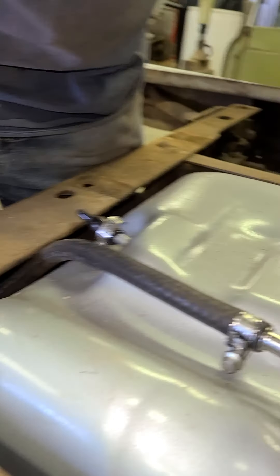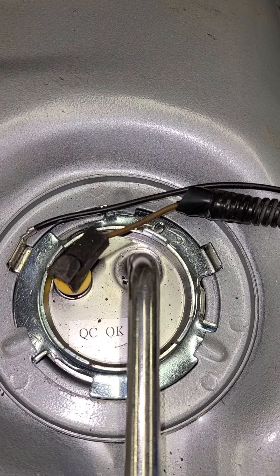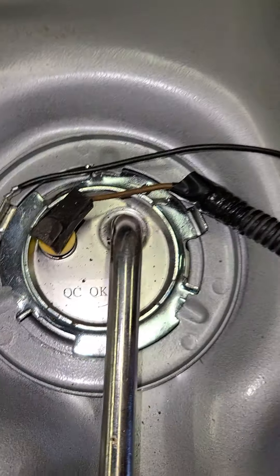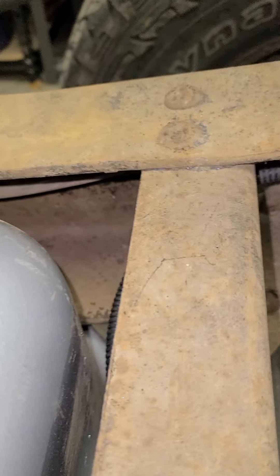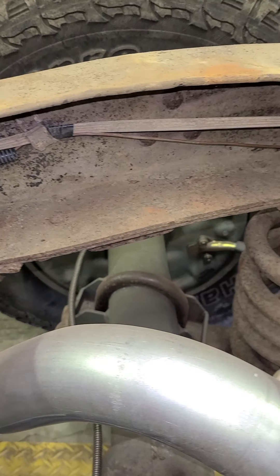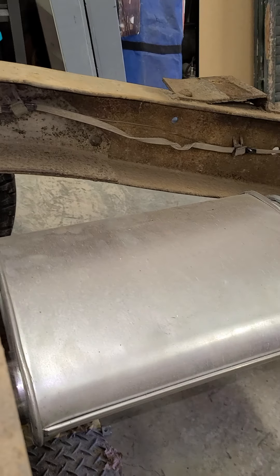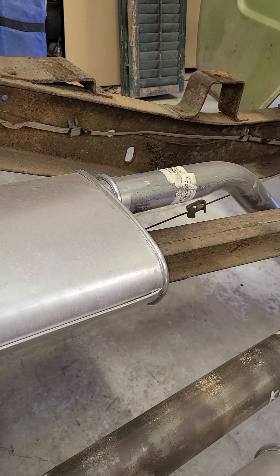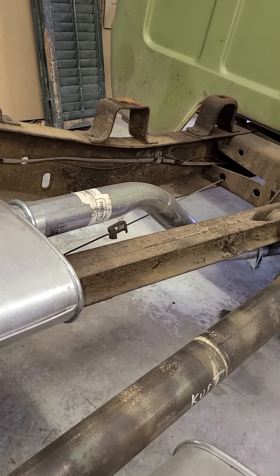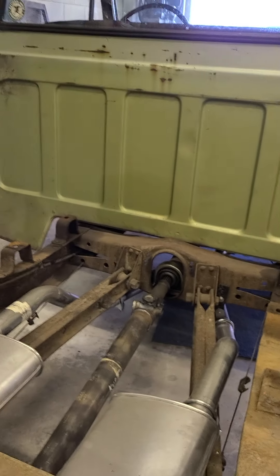Got the wire for the gauge. Got the wire in the tank — that's the original connector from the cab tank. Routed that down through there, just placed in the extension piece. And then followed the tail light wiring up along all them clips, and then where I fished back the rest of the wire from the cab tank, tied it in. That runs up to the fuse block — I just found that out doing this job.